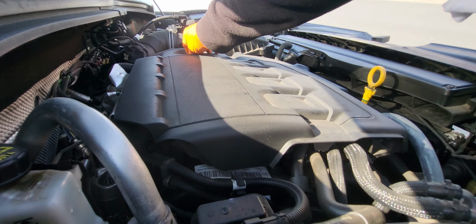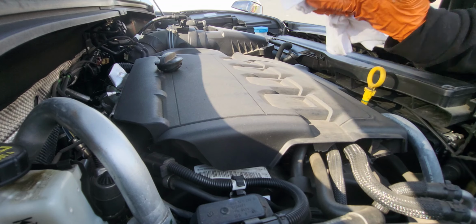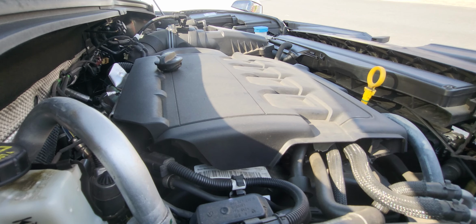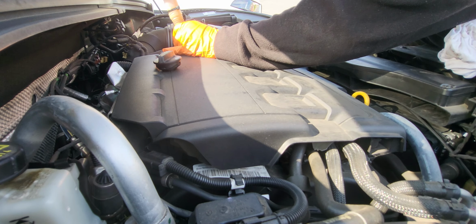So it's gonna top up here. First we're gonna clean, and then we top up the oil into the system. The oil that we're using, since this is a 2002 model, is 5W-30. Normally it's a kind of 4.5 liters. So this is now 4.5 liters.